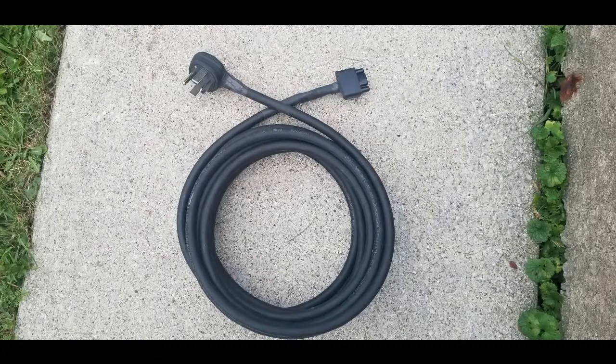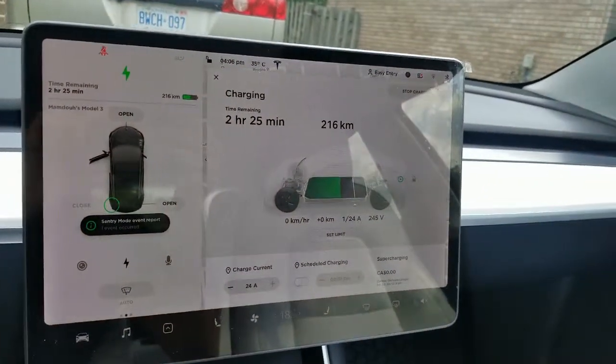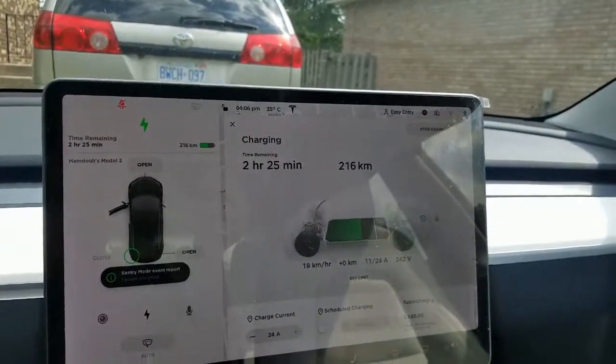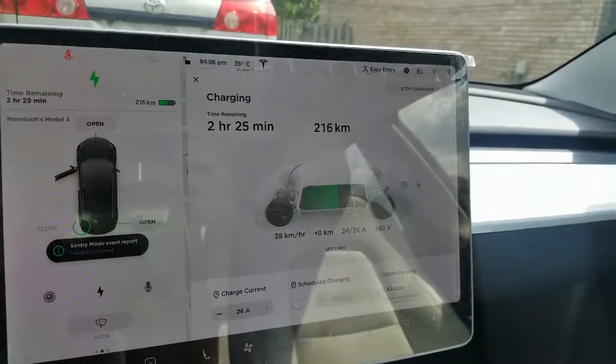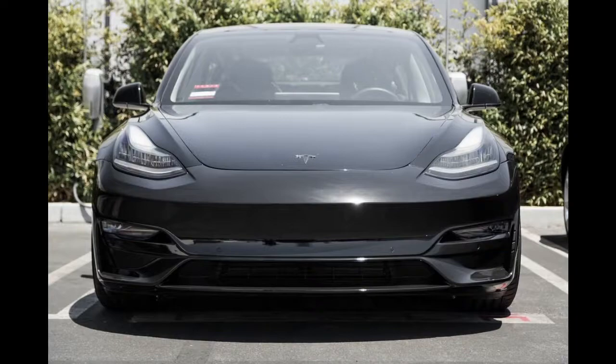Now that it's all done, I won't have to worry about potential electrocution as the connection to the mobile connector is already sealed and the other end is inside my house, and I get much faster charging. As you can see, I have safely and successfully modified and extended the adapter from originally about 10 inches long to about 9 meters, eliminating the need for an expensive and unsafe extension cable. Instead of dealing with 5 kilometers per hour of charging, I now get almost 40, meaning my average charging time from half to full only takes a couple of hours instead of an entire night, which is sometimes a real lifesaver. Thank you for watching.